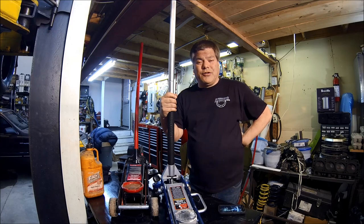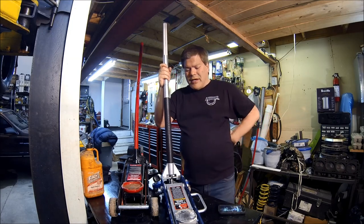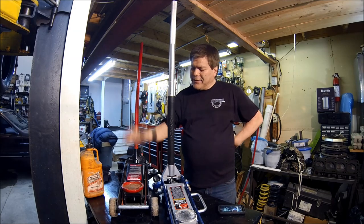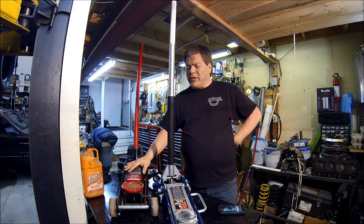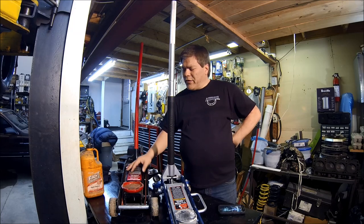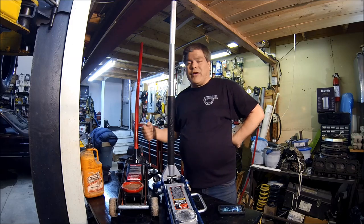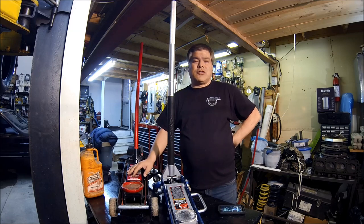So that leads us to what we're going to talk about, which is hydraulics. And what you see in front of you is typically what small-time and amateur race teams have: hydraulic jacks. What we have is your typical big jack, which is probably the cheapest, but you use it around the shop. It's good for, in this case, 3 tons. But it takes a lot of weight to lift it. These are about 70 pounds. And they take forever to get the jack up to where you want it to go. But they're designed for 3 tons, so it's a small stroke and a bigger cylinder for hydraulics.